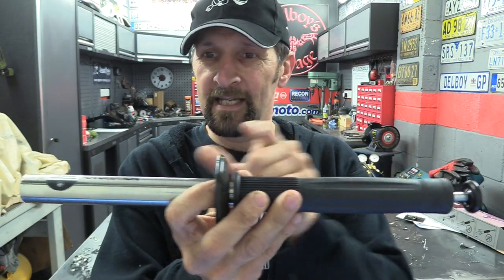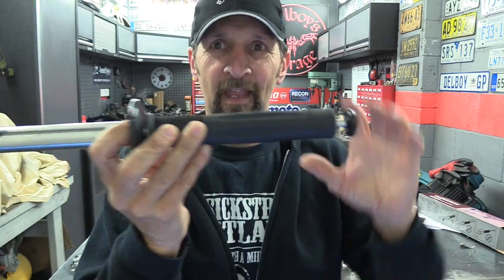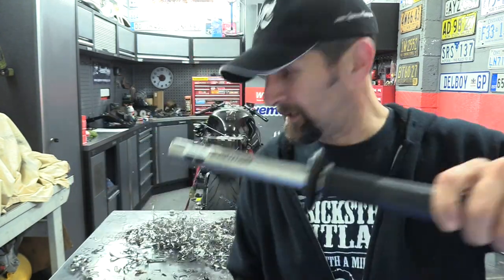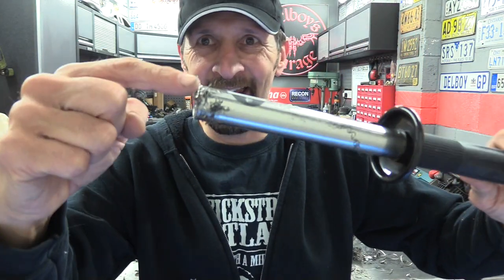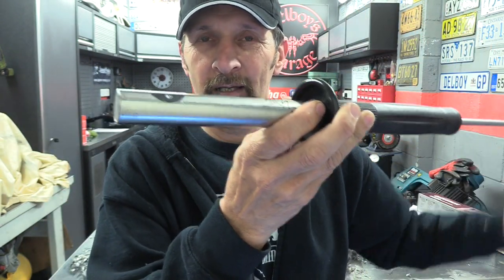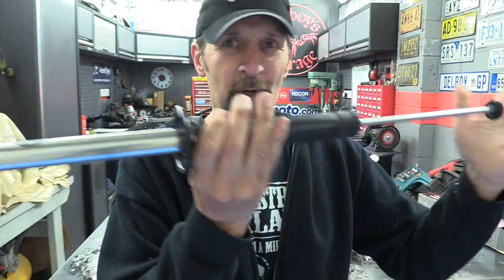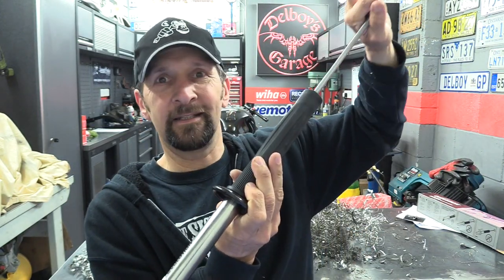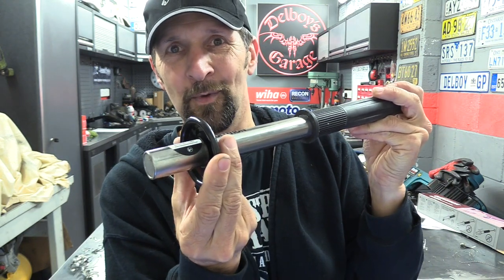What appears to be happening is, as you pull that out, connected to the end of this is a big magnet inside this metal tube. So when that's pushed in, that's magnetic, proper magnetic. Like that. And everything sticks to the end of it. And then you can pull that out, and as you pull it out, it demagnetizes this end. So everything that was stuck to it falls off. So you can push that in, pick up all your swarf, put it over a bin or a box, extract the rod at the back, and it all falls off. And what doesn't fall off, there's this little scraper on there as well to get rid of it.